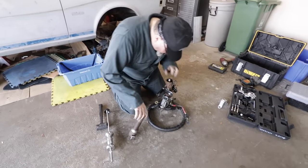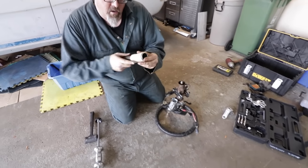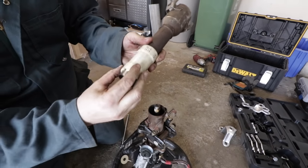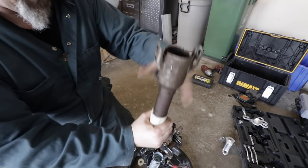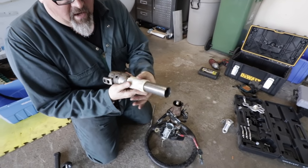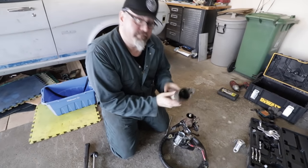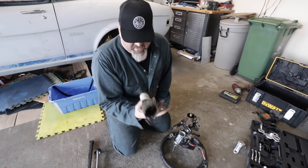So what we have is a collar with small ball bearings, which slides in here, and as the ball bearings are pressed, it basically allows it to rotate a bit if need be. It also allows it to compress. This is basically to allow for a crash. The sleeve has enough tension that it's not gonna move normally, but in an impact, it allows this to slide in and compress, so that you or I don't smash our faces on the column too hard. Impale ourselves essentially.